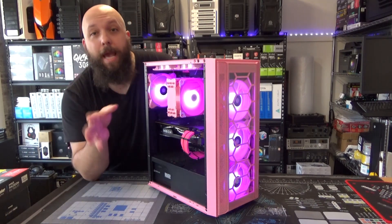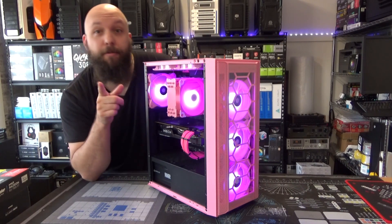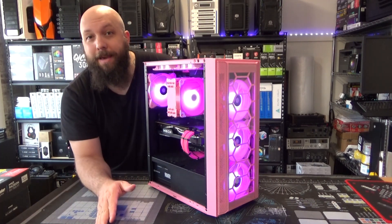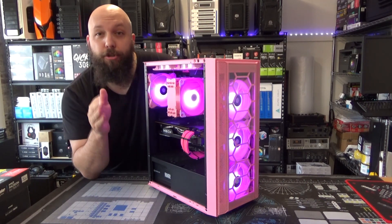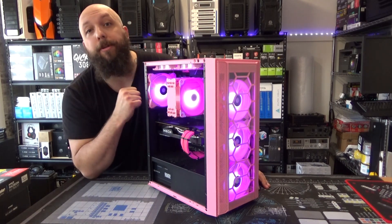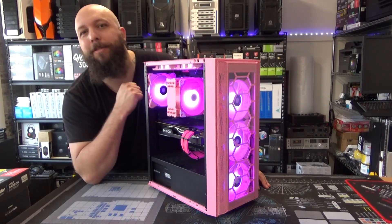If you like this case, you're good to go. As for the parts, I'm happy with this configuration and everything seems to be running smooth. During testing, the GPU ran smooth and topped out at 73 degrees. The CPU on the other hand was running at 95. Now, conventionally speaking that does seem high, but multiple sources have reported from AMD that this chip — the Ryzen 7 7700X — should run between 90 and 95 degrees. That's normal. Our testing with Cinebench R23 showed this running at 95, so we're in range. The noise level was relatively quiet, and that's counting the six fans — seven and eight if you include the CPU and power supply fans.